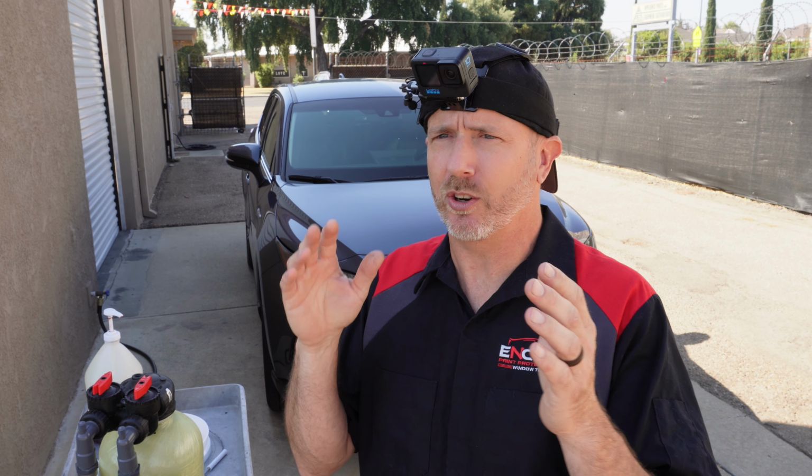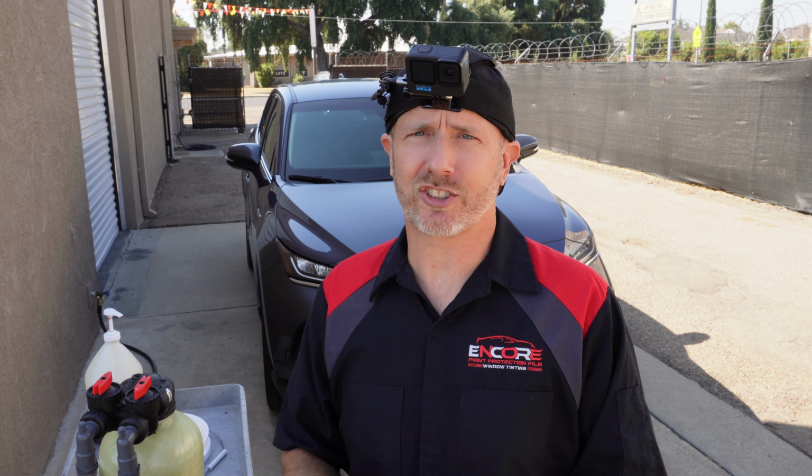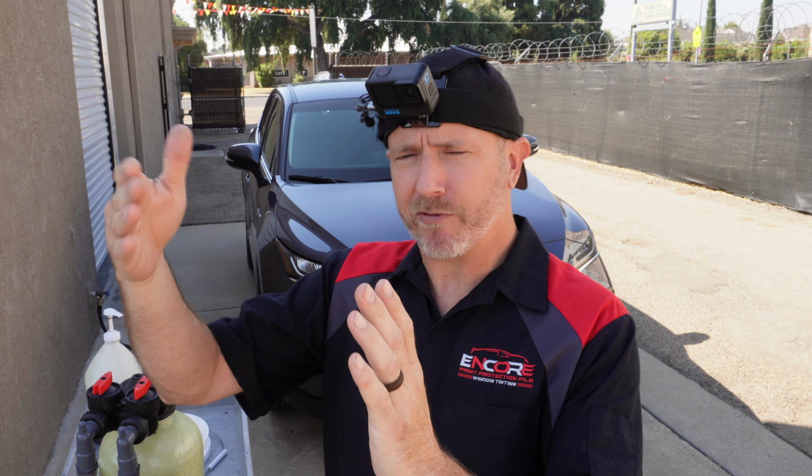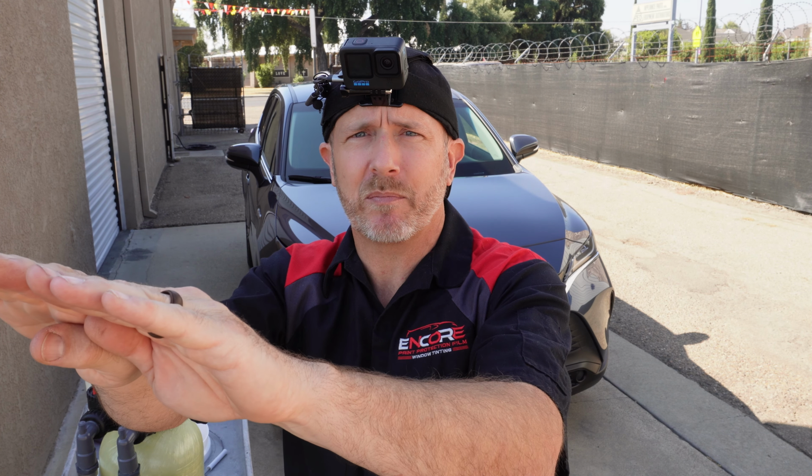It's very important that with the pressure washer, we get every crevice, every nook, every cranny, because there's dirt hiding in there, in between and behind things. We want to get all that contamination out so that we don't have it flushing out during our install. Because you're going to put some water somewhere and it's going to go behind something and come out, or you're going to squeegee something out and it's going to run up behind something and then come back out with dirt. The pressure washing step eliminates a huge portion of that from being a problem.